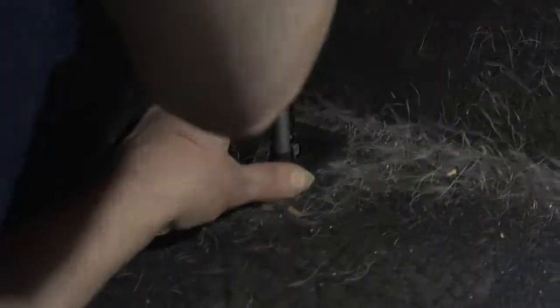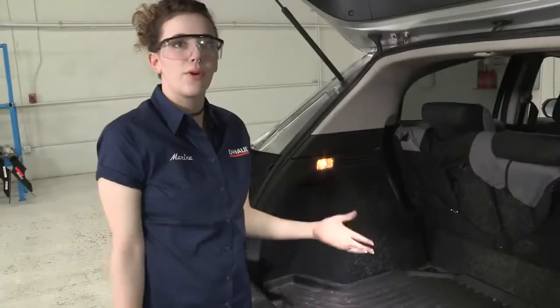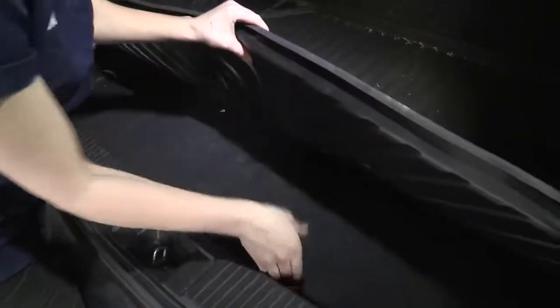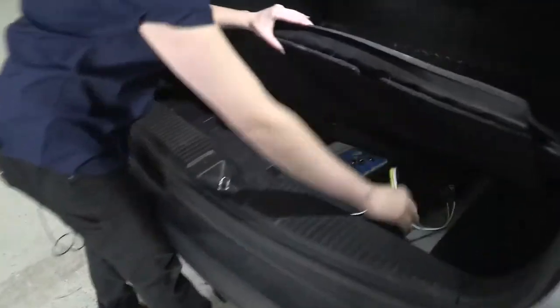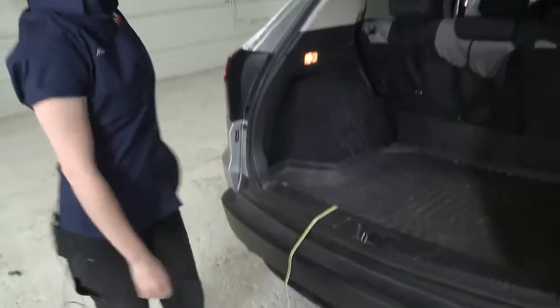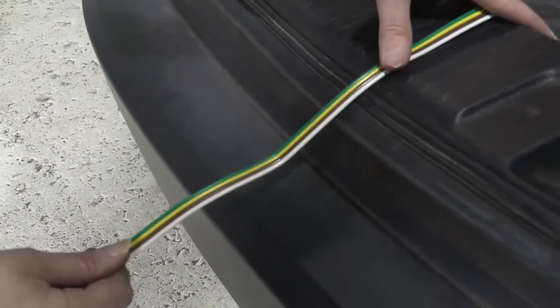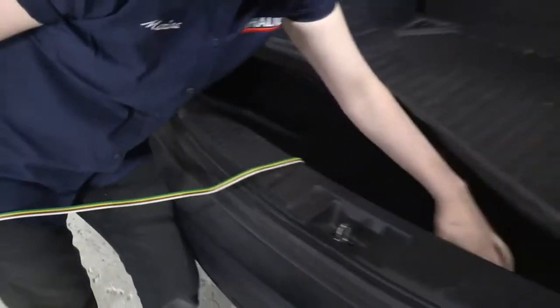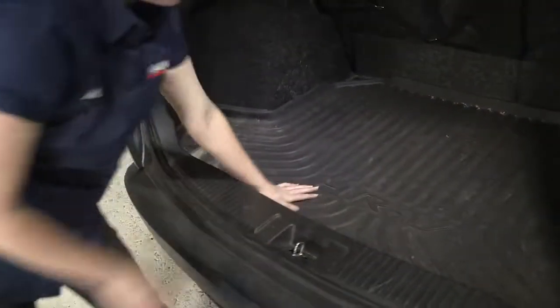So as I'm reinserting this foam piece here, we've noticed we have a little cutout — so that's where I'm going to keep our four-flat for right now. It will be able to pull up along this edge, but it looks a lot nicer to keep the end of it right here so that when we're ready, we can just pull it right out and we're ready for towing. Let's put the last floor panel in and then we'll be all done. Just reinstalling these little brackets here, and then all we have is the rubber cover and we're all complete. The rubber cover here is the last piece that we need to replace. Now I'll show you how to access your four-flat when you're ready for towing — you'll just lift this up, this panel lifts up as well, and our four-flat is sitting nice and pretty right here. If you need a little more length, we do have a small gap along our foam panel where you can pull more length out. We'll leave it here coming out of the door seal — close the door and you're ready. When you're all done towing, you can just open the hatch. The door seal didn't damage the wire at all — it's perfectly fine to close it in there and it's designed to handle that. You'll lift up your rubber cover and the floor panel and tuck it away nice and tidy.